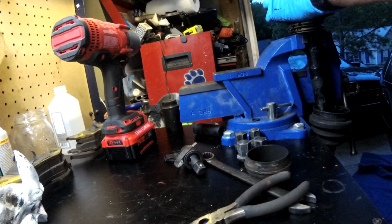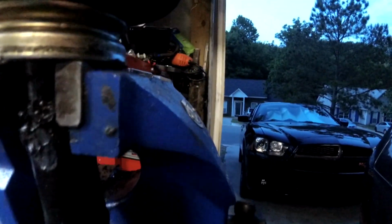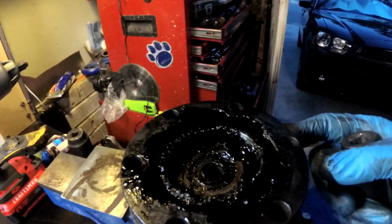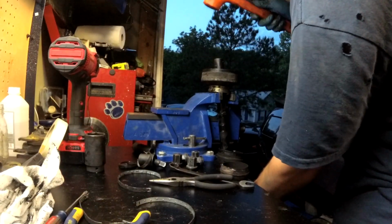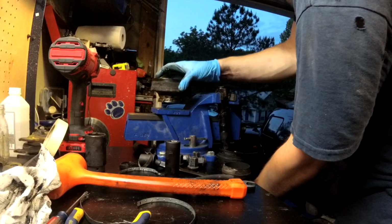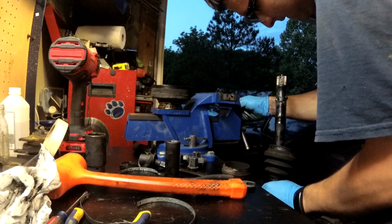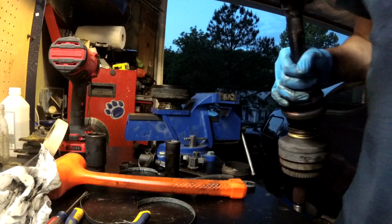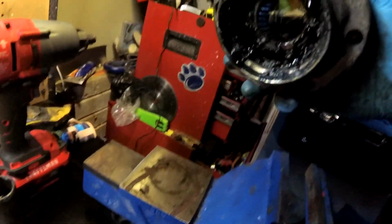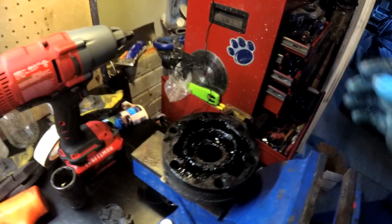Yeah, we're moving it. Yay, we're failing. But that's already put that down below the surface of that. Doesn't look like we're putting enough force on this cap that we're damaging it. We're so close. We're out. Yep. There you go. No press needed. We didn't damage anything, and we got the joint out.